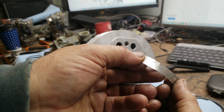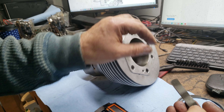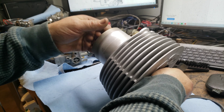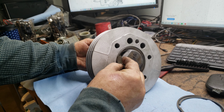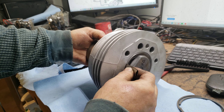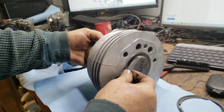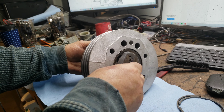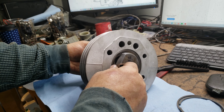I have a .04. So .04 plus .05 would be .09 millimeters, which is incredibly tight. I'm just going to put these together to see where we're at. It is .09 — and that's really what it is. We are above the .065, which is good, because it needs to be at least .055. So we know it's at least .09 millimeters.